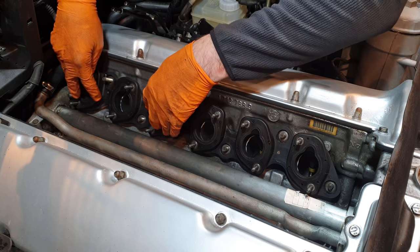I've just realised I should have connected the valve cover breather hoses at an earlier stage — it's incredibly tight to get them in now. I have a whole new set of hoses with the original T-pieces that have a small inlet valve in them. All cleaned up, with new clamps, these will do the job no problem. I should still be able to get them installed fairly easily.